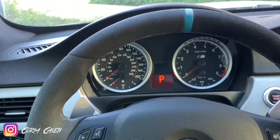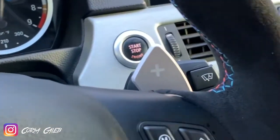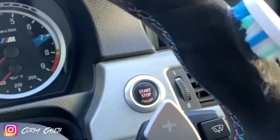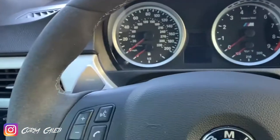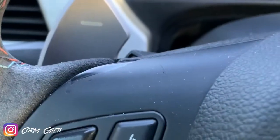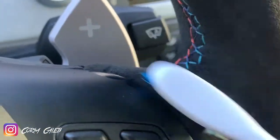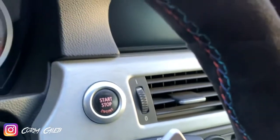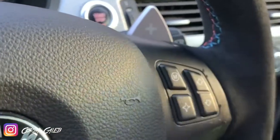We're back after the three cycles of using Sonax along with microfiber. Something else I like to do is put a little bit of Sonax on a toothbrush and give it a good scrub on the parts that are really matted down. I hold the steering wheel at 10 and 2 — where I put my thumb — you can see it's matted down on one side. Using Sonax and really rubbing it hard made it hairy and furry again. You can also see the stitching has brightened up compared to the dusty, dirty side. This product actually works really, really well.